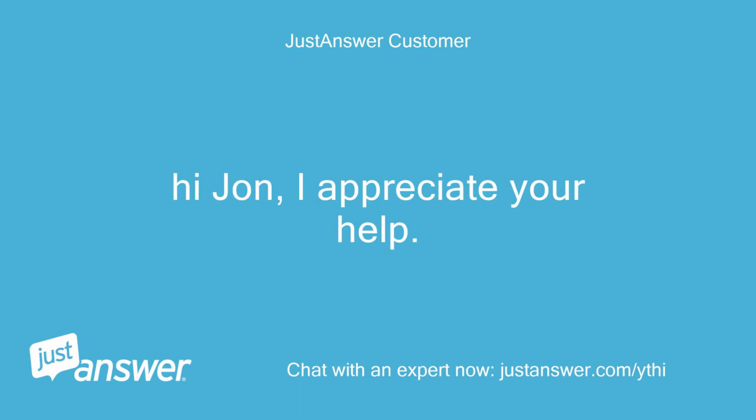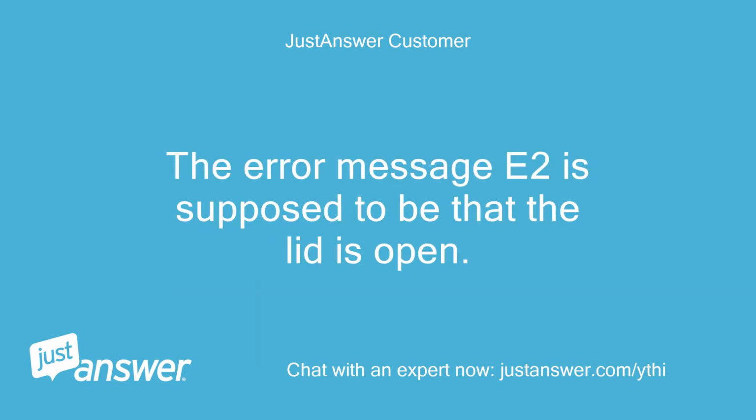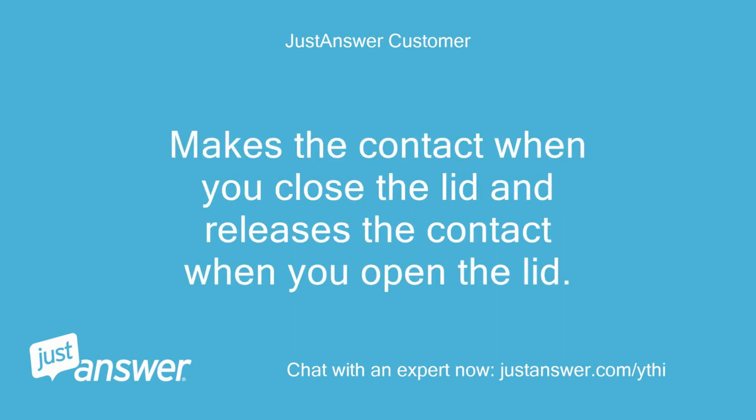Hi John, I appreciate your help. I posted 2 images here, http:/www.bigbolt.com/hire1.jpg, http:/www.bigbolt.com/hire2.jpg. On the first you can see there is a contact that connects to the lid. The error message E2 is supposed to be that the lid is open. Isn't this the switch that causes it? It seems to be working fine. Makes the contact when you close the lid and releases the contact when you open the lid.